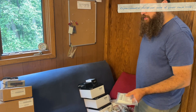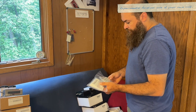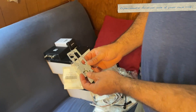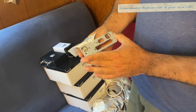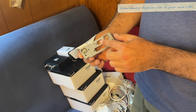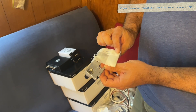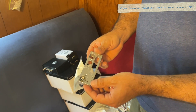We're doing two ADAHRS — so three things we don't have. I'll put that aside for now. So all of the trays that things slide into have backplates where the connectors are attached. There's a big connector, a little connector, and looks like a BNC — yes, there's a BNC here. So this is the transponder — the GTX 45R backplate. As I mentioned, we don't have the transponder yet, but we do have the tray and the tray is installed in the airplane.